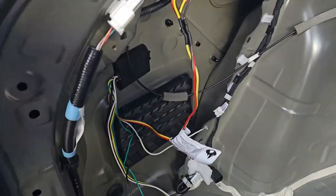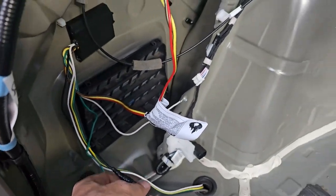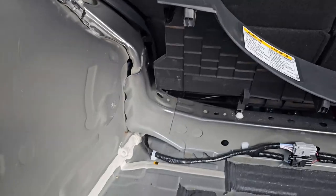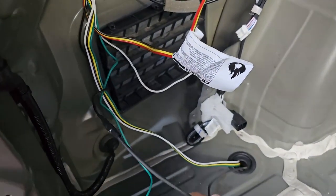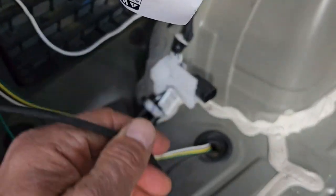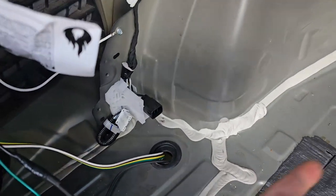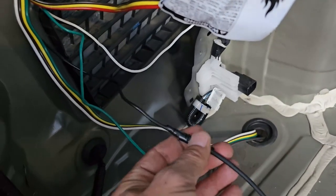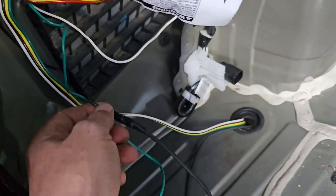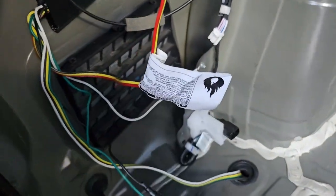Back on the driver's side, the only other thing you have to do is feed the power wire. There's a couple of ways to do it — you could feed it underneath the carpet kit, or bring it up and over through the headliner, all of which is going to be a huge pain. The easiest way is to put it right through that same grommet opening that allows us to pass underneath the vehicle. It comes with a butt connector, and we also electrical-taped the butt connector to make sure it was protected, since all this wire gets zip-tied and tucked into the back.